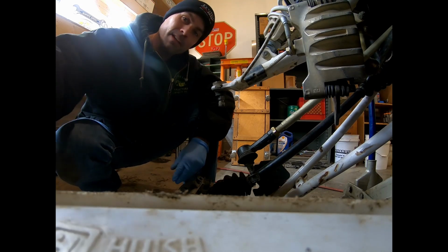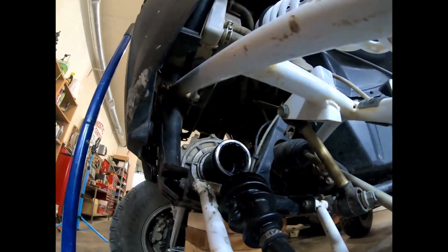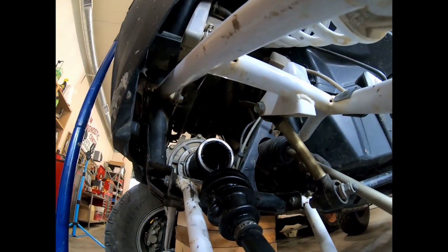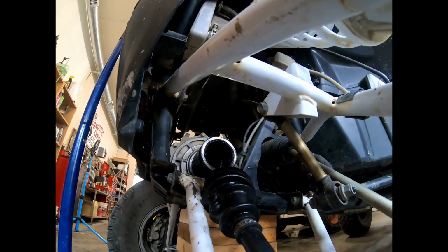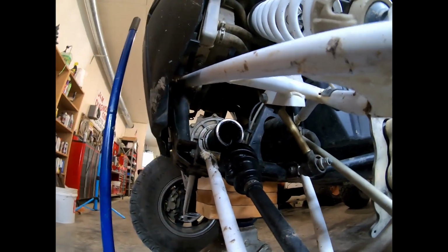Ready to pull out. Yeah, check this out. We are ready to pull out the CV shaft. Now, I'm going to come around the side here because as I drop that thing down, this is what kind of condition mine was in. A little roughhousing, I guess, but I hope that yours is not that bad. If it's in a little better shape, you can actually just tug on the shaft a few times and that thing will pop right out of the case.